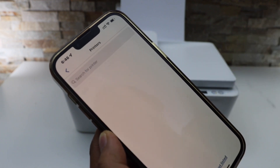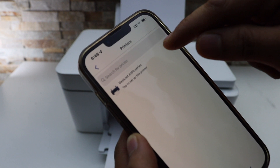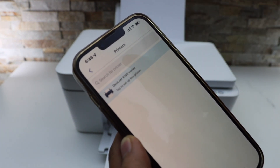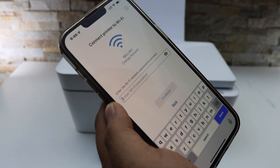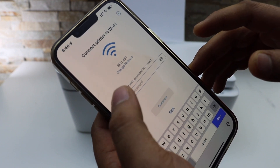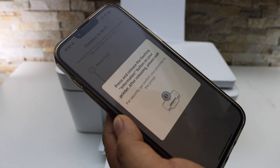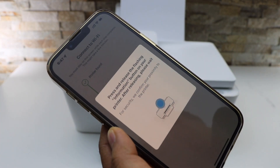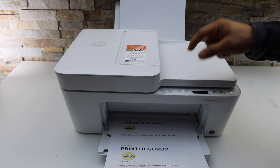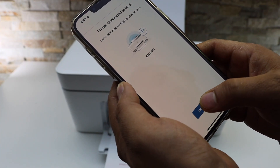Select 'Set up a new printer' and click 'Get started'. It will display the HP DeskJet 4100 series printer — select it. It will display the name of your Wi-Fi network, just enter its password and click on the continue button. Press the flashing information button on the printer screen. The printer is now connected to the Wi-Fi — click continue.